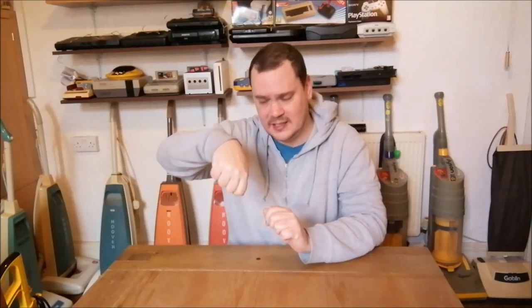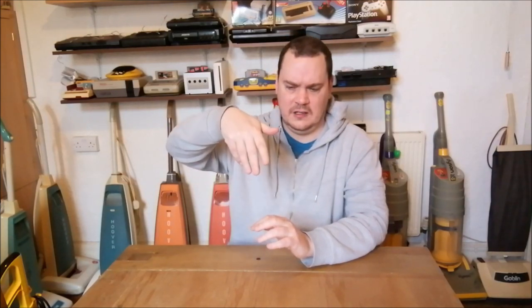I had poked a screwdriver down and guided it in to the back of the dust cup. And that did seem to have latched in, but I really didn't trust it. The seal of it was absolutely terrible. And when I took the cleaner apart, because quite a few of you said, quite rightly, that it sounded horrific, that's because all of the dirt had gone past the filter because of the terrible seals and the fact that it hadn't been put in right. And it had just clogged up the fan. So the fan was absolutely, completely and utterly clogged up with hair and dust and bits of paper. So that did not help the noise situation at all. It made it a million times worse. But as I say, I've done a little mod to it, and surprisingly, it seems to have worked.